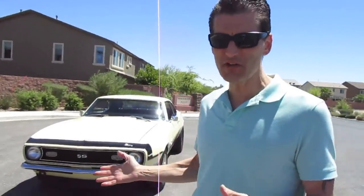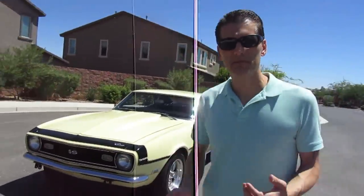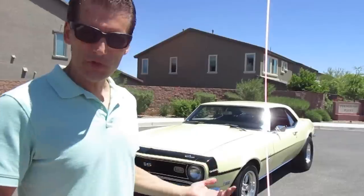Let me tell you a little bit about my car first, so maybe you can make a comparison to a car you have. This particular one is a 68 Camaro Supersport. It's got a 406 cubic inch race motor in it, a four-speed automatic with an overdrive, and I'm running 4:10 gears to a Dana 60.